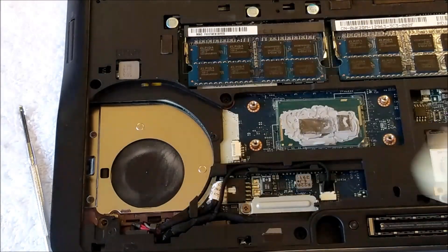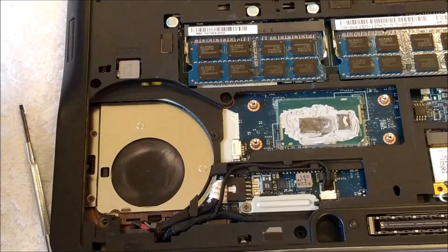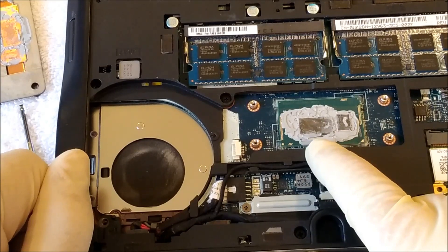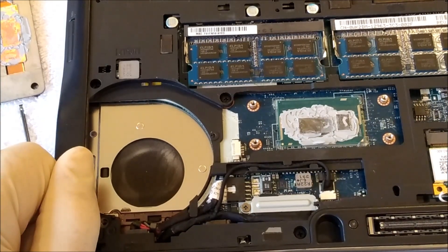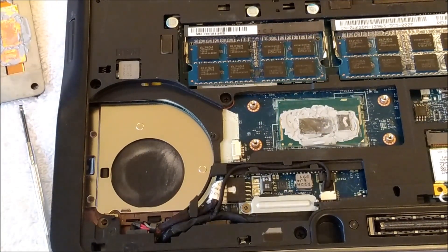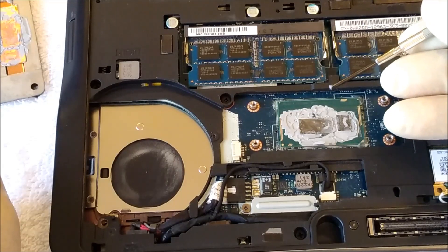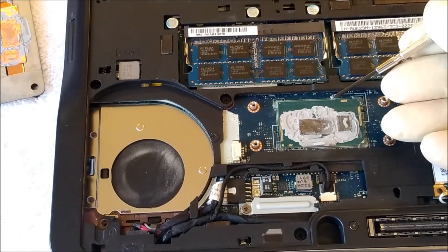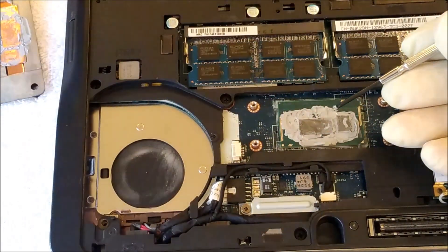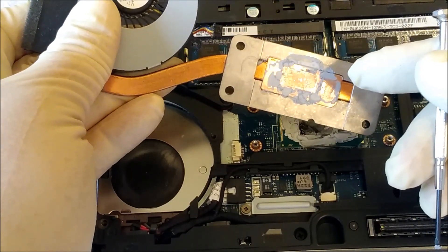She's a little dusty in there. We'll take that out and hit it with some compressed air. And holy crap, look at the absolutely terrible thermal paste job somebody did on this. Let's see if this stuff is from the land before time — oh yeah, that is ultra rock hard. That's exactly what I expected to find. That's why we're doing this. That stuff's super gross, it all needs cleaned off properly. And somebody did a really crap job of it — look how way too much they used.